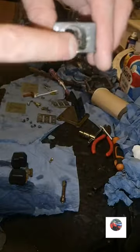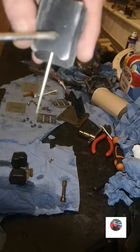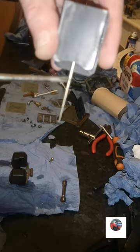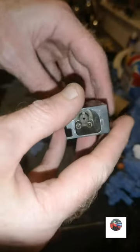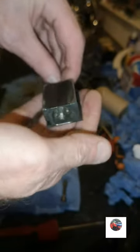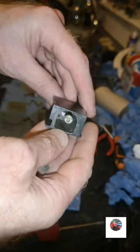We'll just check which clip the circlips are on the needle. See if there should be two little white plastic spacers, one on each side of the circlip that goes on the needle as well. We'll check for that as well. So that's the two screws slack. Just push the pin from the bottom. Just catch everything.